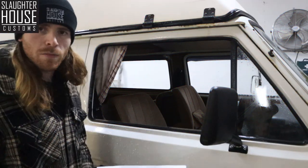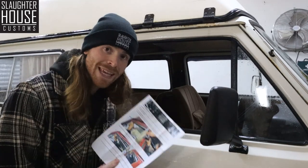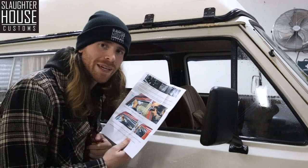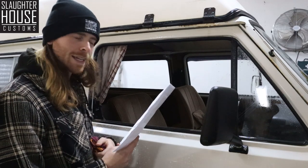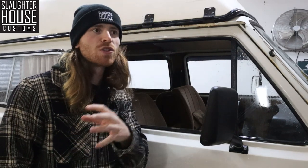The cool thing about pretty much all of our products is we have fitting instructions — lots of big pictures for people like me who need them. So step one: roll your window down and clean the inside of the window channel. Use a clean rag and maybe some isopropyl alcohol to make sure you've got a nice clean and dry surface to stick your wind deflectors to.